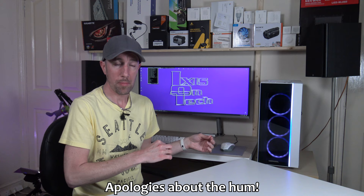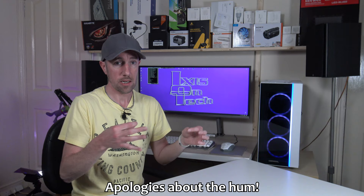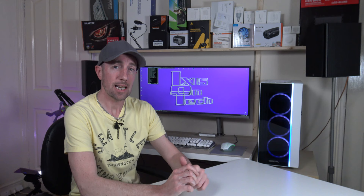They're all wired up — right speaker and left speaker. When I wire up my speakers, I put the strands of wire with the writing on them to the black, to the negative, and then to the negative on my amp. Some people put it to the plus; I personally do it to the minus. I also recommend investing in some banana plugs — they plug directly into the back of the speakers and make the connection much easier rather than fiddling with the nuts and threading the cable through.